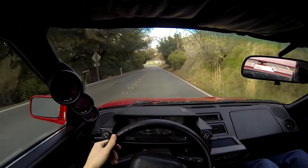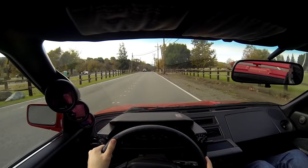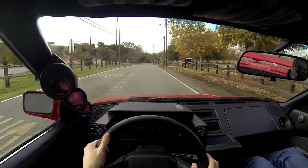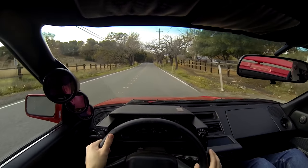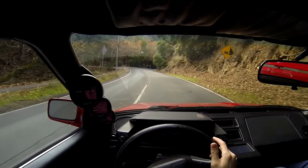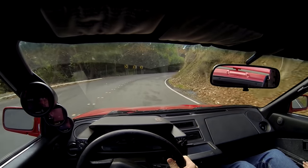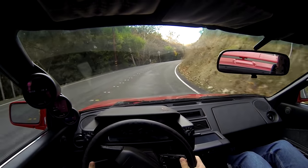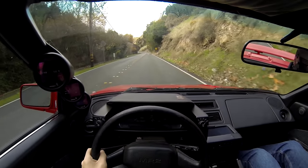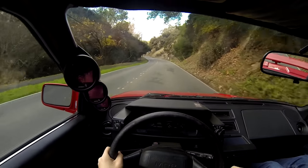The second area — I think the car just isn't fully at operating temperature yet — but the brakes did feel a little bit mushy. That being said, once you do step on it harder, it does get the car stopped. I think maybe the pads or rotors are a bit cold and they don't have full grip between the rotor and the pad. Another thing is that the revs drop very quickly when you push the clutch. It's something I haven't gotten fully used to yet. When doing heel-toe downshifts, I have to blip the throttle more than I typically do to get the revs high enough so that when they drop back down, it's at the right revs for the next gear.